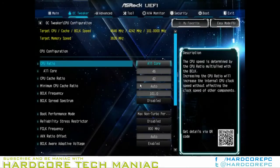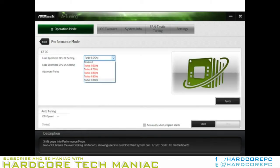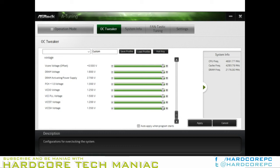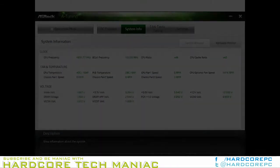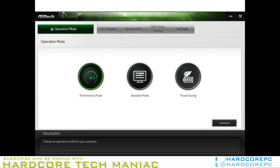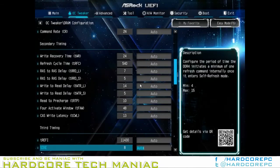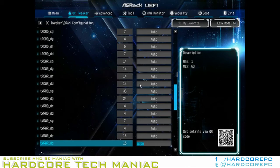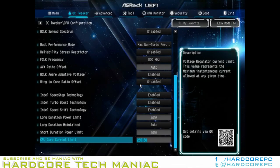Memory overclocking was also a little disappointing, with G.Skill DDR4-3866 stable only to DDR4-3570 as a full 4x8 GB set, and DDR4-3708 as a 2-DIMM half set. Like most enthusiast market boards, the Z270 Extreme 4 has a hidden plus 20 mV DIMM voltage offset, producing a measured 1.353 to 1.354 V at the motherboard's 1.330 V setting. This is likely used by motherboard manufacturers to achieve a compatibility advantage with super-fast RAM, but memory manufacturers have also come to rely on that extra voltage. While I'd like everyone to be upfront about this, the fact that hidden overvoltage is now universal makes it impossible to blame a single manufacturer.